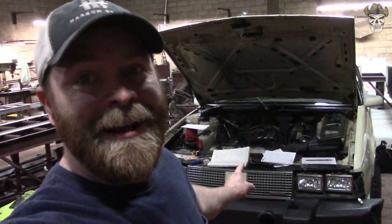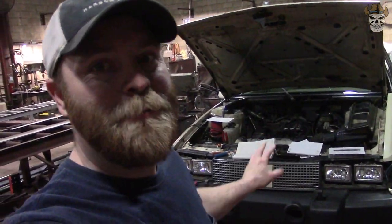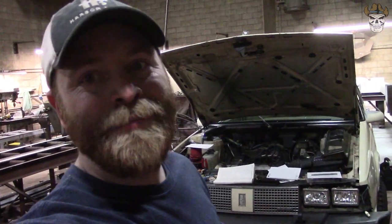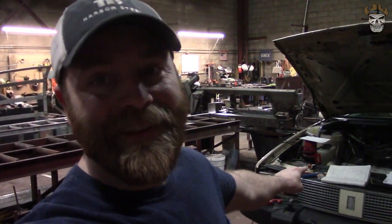And after the diagram and people coming down here looking at it, I'm gonna take the 194 wiring here, splice it into the halo eyes, and call it a day. I'm gonna have to have my headlights or my running lights on for these to work, and I'm completely fine with that after this. I am just fed up with it. So let's get these wired in. Hopefully these will work. Then I gotta fix the mess I got over there, get all that back to normal, and then wire those in. So yeah, ouch.